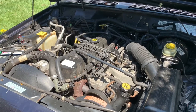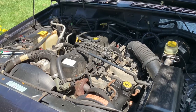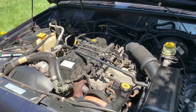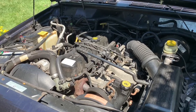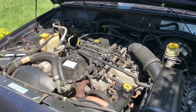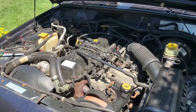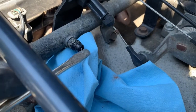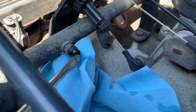It's taking all of my energy and resistance not to take the entire intake manifold off and repaint it, but I don't have time for that today. All we're doing is the fuel injectors — not fuel injectors and intake manifold and exhaust. As soon as I take the intake manifold off, I'd break a couple exhaust bolts and we'd really be screwed. We want to release the pressure on the fuel rail, so we'll just take a screwdriver and push the little Schrader valve in. Some fuel will spray out — just be careful.